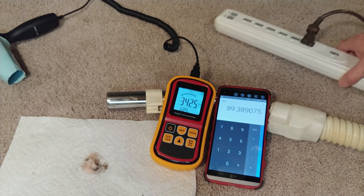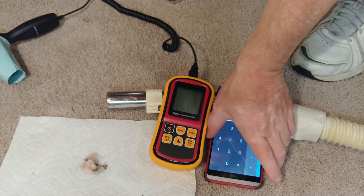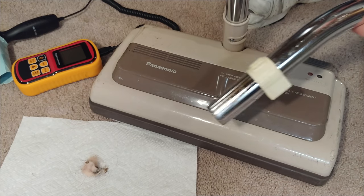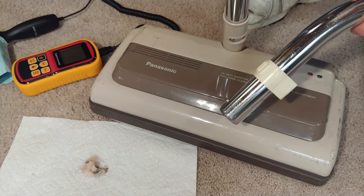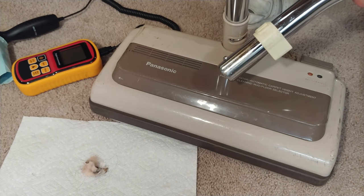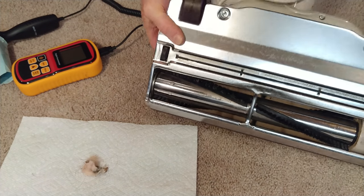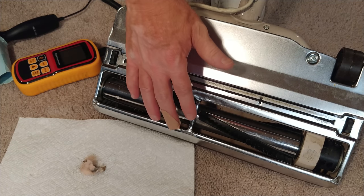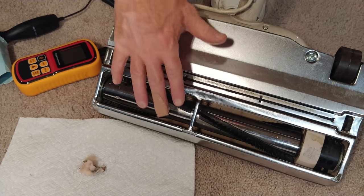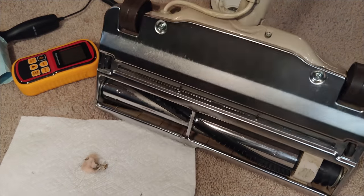So if I had to guess — and it's going to be a guess — this is close to 90 at the hose end, and if we hooked the whole power nozzle up, you might end up around 70 CFM, because typically I see about a 20 CFM drop. This thing could be leaky because of age or design, but the maximum I'd probably say is around 70. And since the brush roll opening is Kirby-sized — that is sizable — 70 CFM probably wouldn't be that difficult to push. If it had lower because it's a big leaky mess, it would be super easy to push.